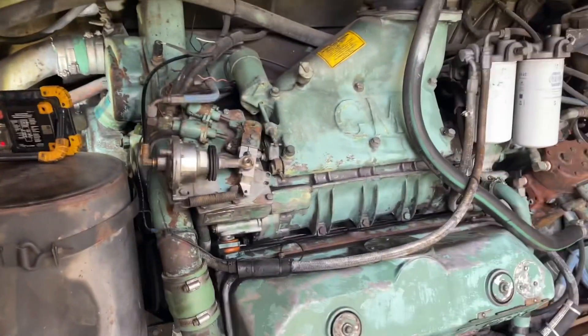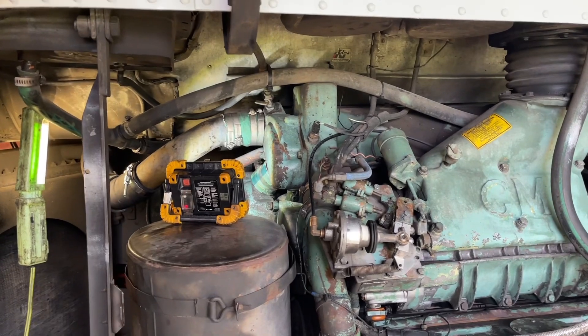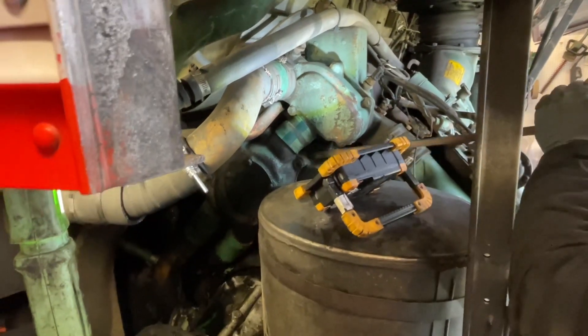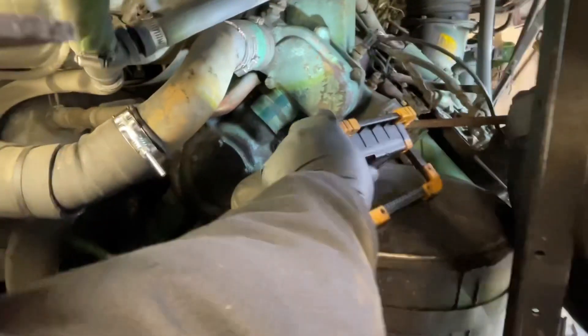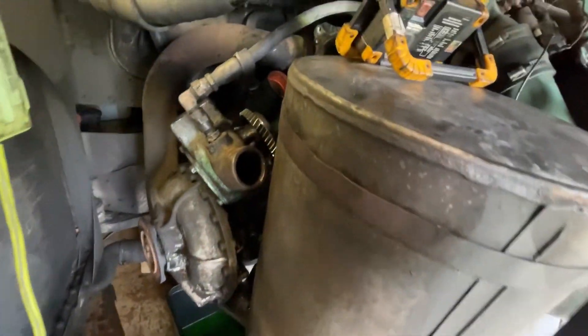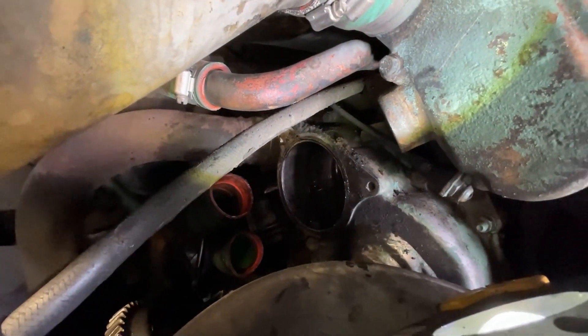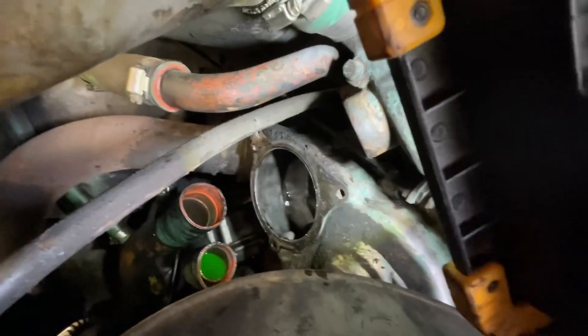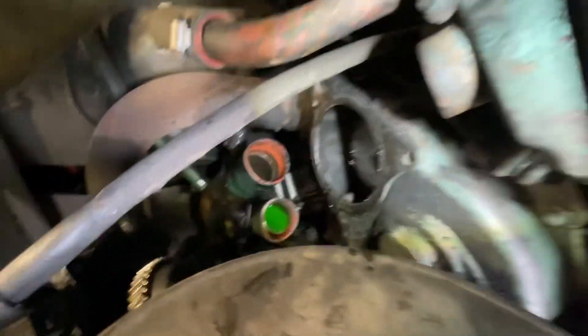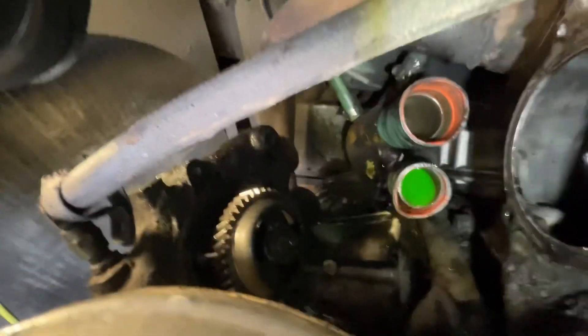I brought you one. Is it too big for the job? No, I think we're good — it's behind you. Yeah, you're getting it. Juan got it off of there — He-Man style. It's just brute force, really, or a lot of strength. Those three hoses are real tricky, but that surface right there on the block — that mating surface — that's what's been leaking, and the O-ring is in there.